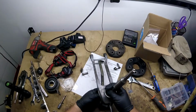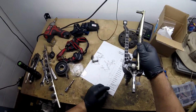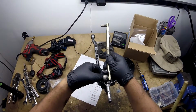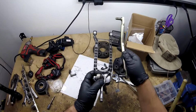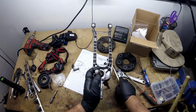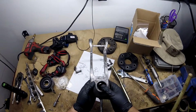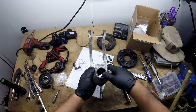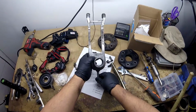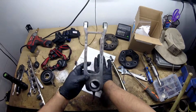Since that's free, you go underneath the car, and there's a locking clip. I don't have it with me now. It slides in here, and you release the clip, and then this comes out, and it just sits in there. You can't get to the other end. So it sits in there. Then you pull this out. It comes out entirely. Once that's out, you can push this forward inside of the car, and this will drop down, and it just falls right out. You just slide it through. With the transmission down here, it just slips right past it.